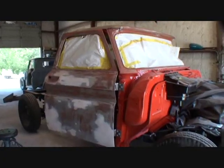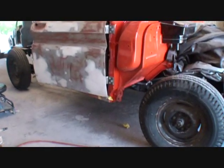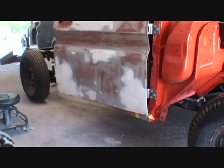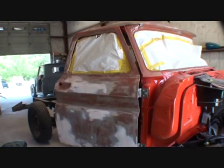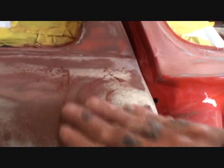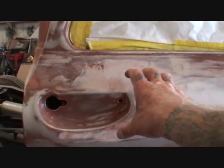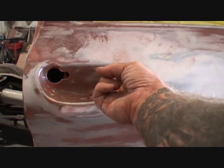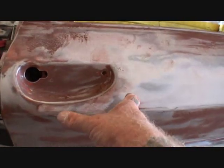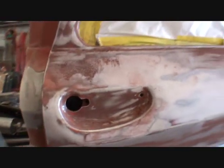Over here we got the same situation — bodywork on the door. You can see where the two corners are. That had major rust repair in both corners, which is common on these old trucks. We went ahead and fixed that. We have hand sanded, block sanded, and DA sanded this door down. You can see how nice and clean the old paint comes right off when you use 80-grit sandpaper. That's ready for priming as well. You saw how we used the slide hammer — this was all crushed in in this area. We took our slide hammer and used the old door handle to pull this all out and get it back in shape. The door handle fits on there great.